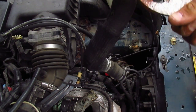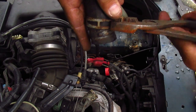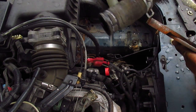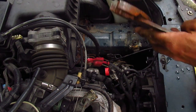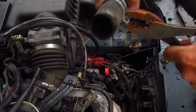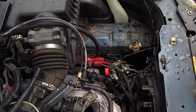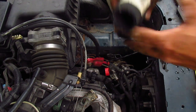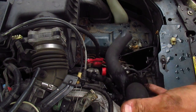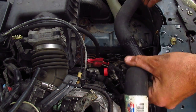These clamps are just no fun at all. You get your pliers on it — maybe Snap-On has a tool for these — and then you drop things in the engine bay. Now the clamp that goes on the radiator side, I really don't think I should reuse this, because it's going to be hard to get at it next time. Spring clamps — who uses them? Chances are I'm not going to be replacing the hoses on this car ever again — this car's got 250,000 miles on it. But just to make it easy for myself, I'm going to use a screw-type worm gear clamp.